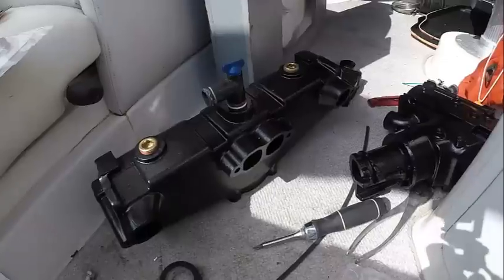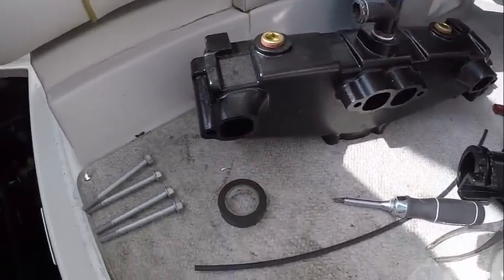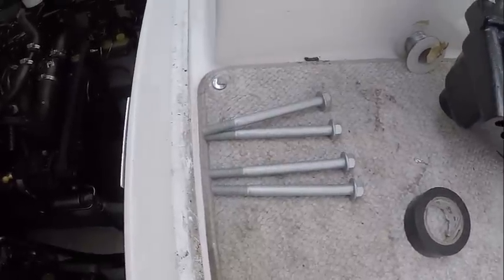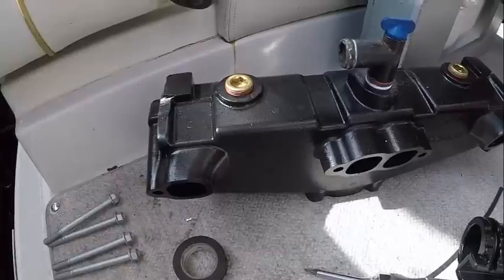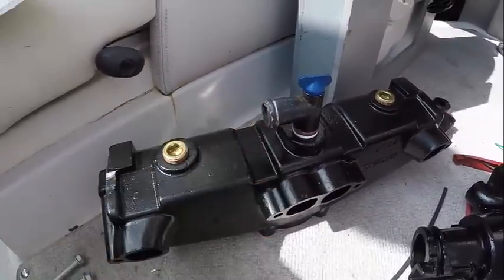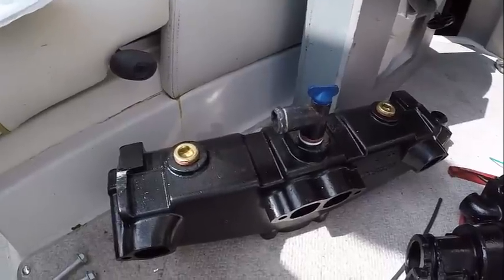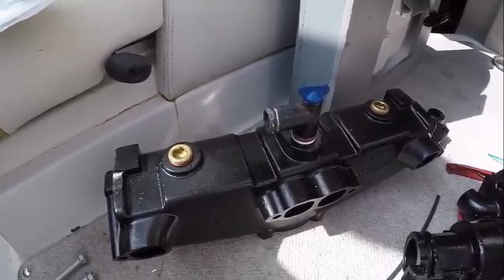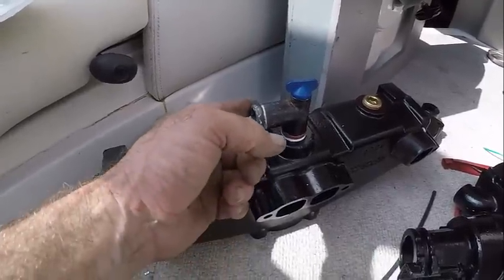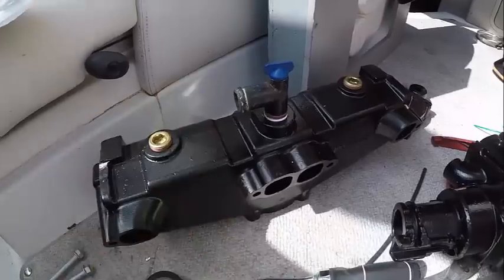So on to the boat. Things are a bit cramped here. Now there are four bolts that hold the manifold on — they're in line and they screw into each of the four ports. The bolts come with the kit. Always a good idea not to reuse the bolts — get new bolts. Also this did not come with the kit: this is the water injection for the bottom of the manifold, cold water injected through there to cool the manifold. Make sure when you put these in you do so before you put the manifold on, and one faces one way and one faces the other way. Make sure when you put the manifold on the engine that this faces the direction the hose is coming from — on my boat that happens to be from the front of the engine. So this is going to face the front of the engine when this manifold goes on. Get these right, otherwise you'll be hating life.